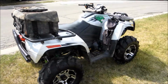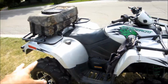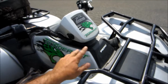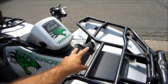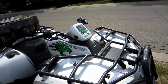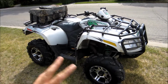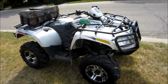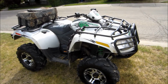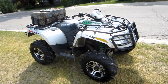It's a great machine. I did a few mods to it too. I opened up the exhaust a bit, intake, and there's a breather mod you can do for the crankcases. They do crankcase ventilation. It's smaller, so it's all bored out with large hoses and stuff. It made a significant difference. The EFI runs kind of rich on these things, I think, to compensate for all situations, so you can smell a little richness coming out of it, but it made a difference. The thing is, it's plenty fast. It's not blow your mind fast, but it's pretty fast.